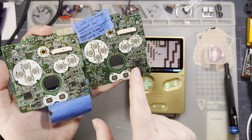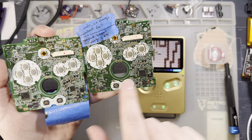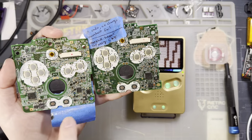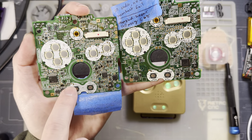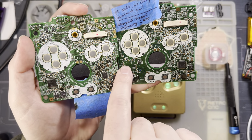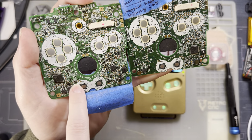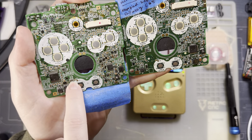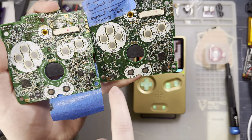Smartphones and the like do this exact same thing. It's compatible with both models. It does not matter which one you have, since most of the points that you're soldering to are these test pads, which are in the exact same place for both models. The only exception is the amp also has to be soldered to these little capacitors right here, which are not present on the one chip model.